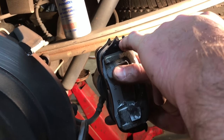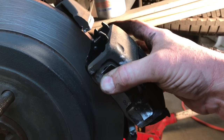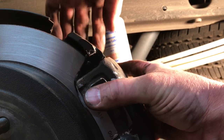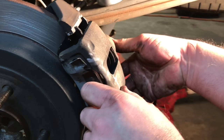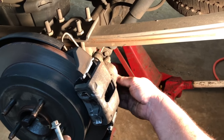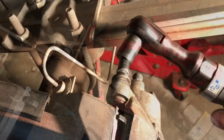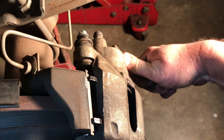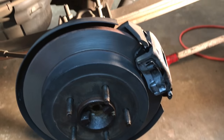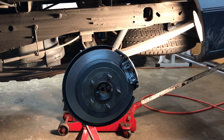Notice that the pads have two notches, so this has to lock up around the upper part of the caliper bracket and then the bottom part will slide in. You may have to pull your caliper slider pin back just a little bit until it falls into place and do the same thing on the back side with the bottom. Now we'll put our two 10 millimeter headed bolts in, start them by hand, then snug them up with a wrench. You can use a torque wrench on this — it's probably better that you do. The spec is approximately 18 to 20 foot-pounds on those small bolts.